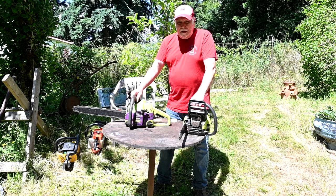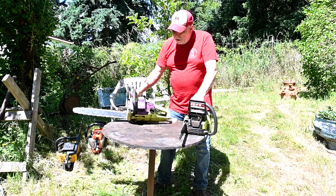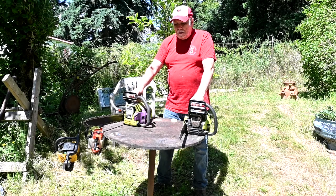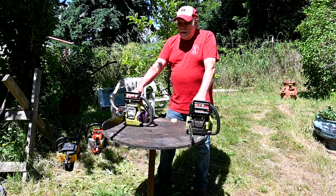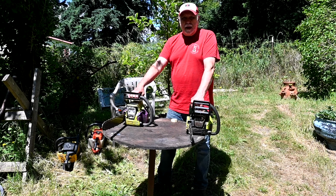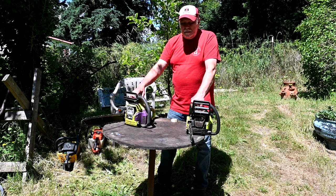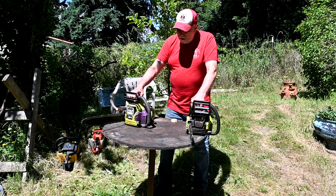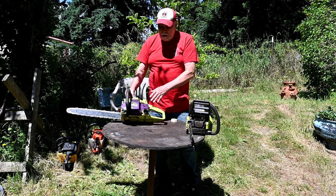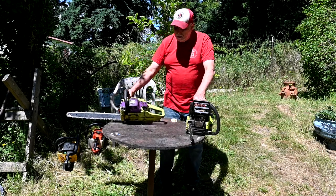And, you know, hot rodding's alive. But these things are so cheaply built that once I got this to run and perform really good, the crank failed on it, which is a common problem. I was given 3 part saws, 2 Wood Sharks like this one and another Wild Thing, and 2 out of the 3 had bad cranks on them. So the main bearings are fitted into a plastic cage and it atrophies and leaks air and then they blow up. So this one, when it quit, the bore seems to be pretty good. So this will be an upcoming project pretty soon. I'm going to take it apart and see if we can salvage it because the bearings and stuff are available.